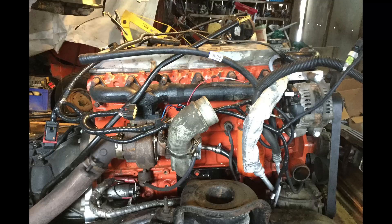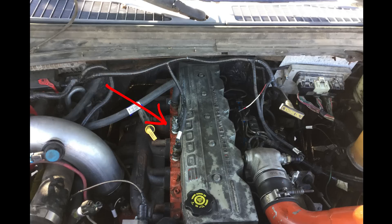On the passenger side you can see where the rad hose is going to come out of the bottom. I used all the existing rad pieces from the 6.4 and just cut them to suit since I used the existing rad. The air conditioner line is just pulled up and bent out of the way. You can see the alternator bracket and the 6.4 starter. On top I used the transmission and temperature sensor, stuck them in the two ports out of the top of the block — as long as these two sensors read the same temperature it will trick the computer and everything will work fine.